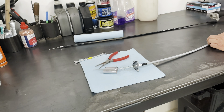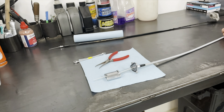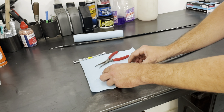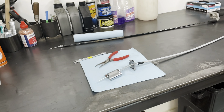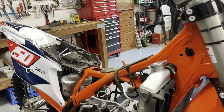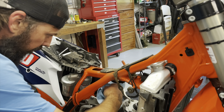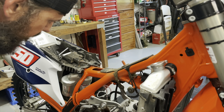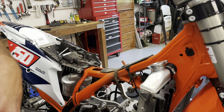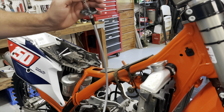I'm going to do a little test — pull this cable and pull on your slide to make sure it's definitely in. Now I can set this down to the carburetor — that's our next step. I took a blue rag to wipe down any debris on the top side of this carburetor that would drop down into the carburetor and plug up a jet. It wasn't dirty, but just got to re-verify. I also took a blue rag to the o-ring on the top side of the slide cover — and it's clean.